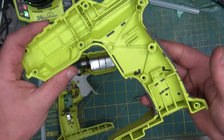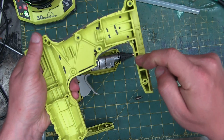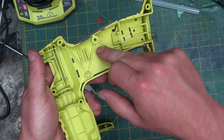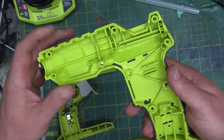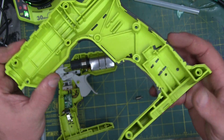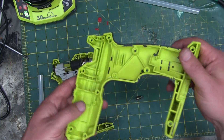A couple of surprises in the material and the construction. Very sturdy, rigid, boxed — this is extremely rigid. Lots of details here, which gets expensive of course. They are using glass fiber reinforced PA66 — that's like a nylon, but a different style of nylon. The 6-6 is a little bit more expensive material than just the 6.